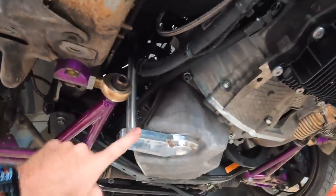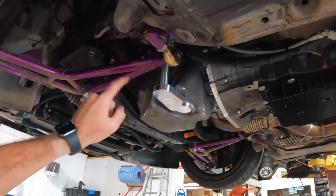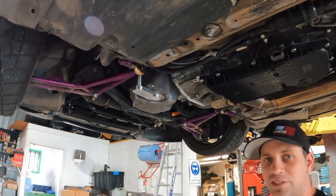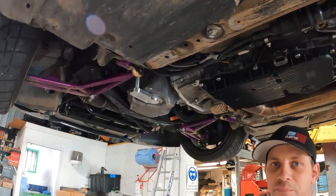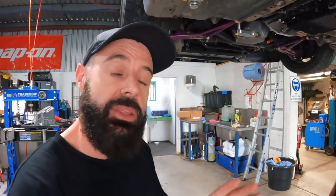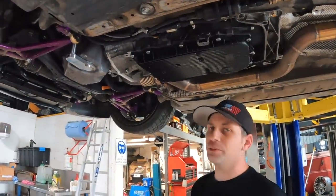This version is for the E46; the one for E9X and E8X chassis will be slightly different. Dan has made a few of these over the years for race cars, and has now gone to a billet version so it's easier to replicate and sell as a kit for E82s, E92s, and E90s. When Dan installs these on customer cars he makes a small modification in the custom map so the ECU doesn't freak out that the original sensor is gone. There are S55 versions out there costing upwards of £600, with some nearly £2,000 — and none available for the N54.